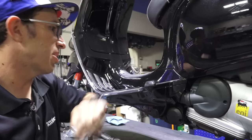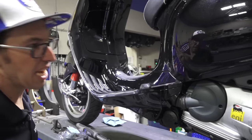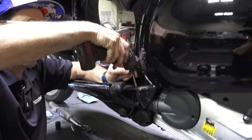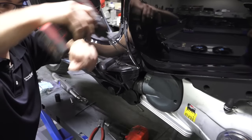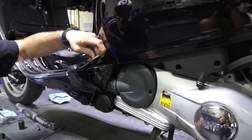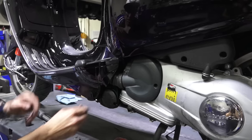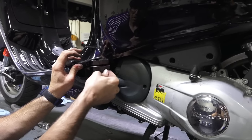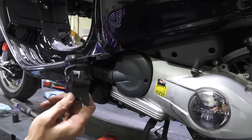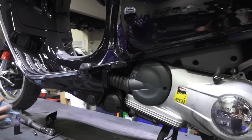Now I'm going to start from the front and work toward the back to dismantle the belt cover and gain access to the transmission. First, get the little cover off using a T30 driver. Pop the single Torx screw out, lift your floorboard, and this little corner piece comes out. Make sure you put the screw back, because this little piece tends to go missing if you don't.